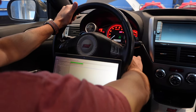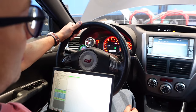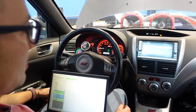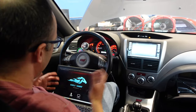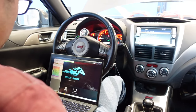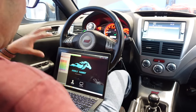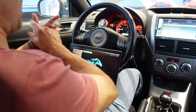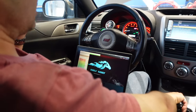The car is flashed and doing a cold start. This is full speed density, and one of the challenges with tuning speed density is getting a nice steady stable idle on a cold start — and as you can see in this case it is nice and steady and stable. We tune with both ECUTek and the Cobb Accessport of course, and we can see all the data. I've got my presets here for tuning this car and can start data logging right away. You can do this at home as well using the ECU Connect app on your phone and then send us your data logs.